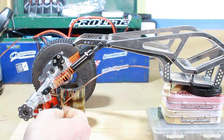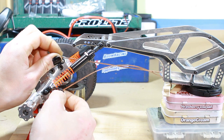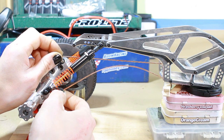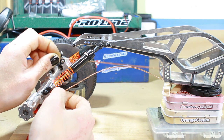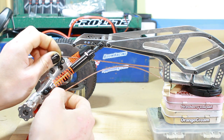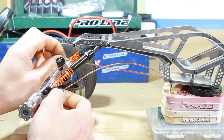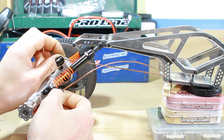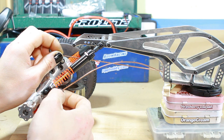The rear link setup is going to look something like this. I used some welding wire to mock up my link lengths, and I think that's roughly going to be the way it'll sit. I'm concerned about interference right here on the upper and lower. I may be able to do something really ridiculous and run the upper under the lower, which I think is kind of silly and defeats the purpose of the lower being bent as much as it is. But again, we'll have to see how it turns out.